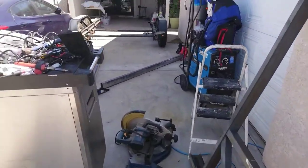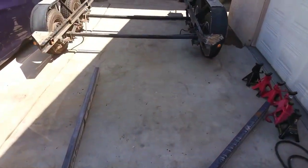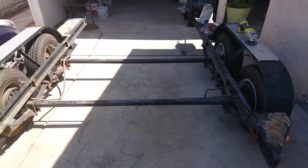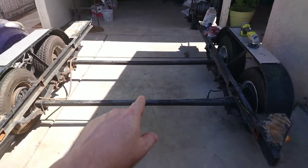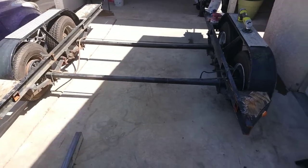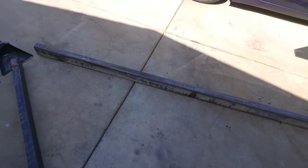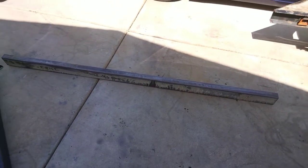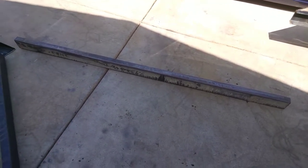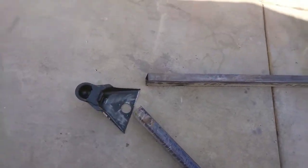I'll post another video once I'm done and let you guys know how it came out. My idea is to build this trailer light, because I think my towing capacity on my RV is only 8,000 pounds. I weighed this section here and it came up to 600 pounds, so we're off to a good start. These pieces of steel I have are about a pound every two inches, so the whole length is like 33 pounds. Structurally, the square tubing is going to be a lot more ideal.